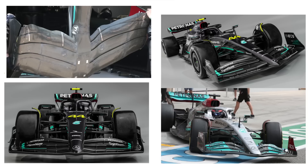As to the main front wing, it's fairly vanilla through the center. It's clearly a little bit more centerline loaded this time around — a little bit more cranked than last year's, which generally dropped down more in the center. Looking at last year's shot from below, you can see how nicely those profiles merged into the undernose region, which would have been very clean. Maybe they've pulled up the nose to achieve this effect, or maybe it's an optical illusion and the centerline is where it was and they've actually backed off the mid portion — both options are available.